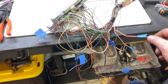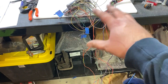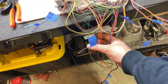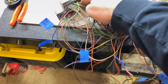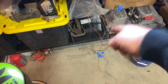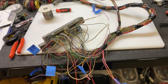I could do the two-relay style and add fans on later, which might happen — I don't know yet. I do like having an open wiring system because it's easier to maintain, but a sealed system looks tidier. I'm going to have to tidy these wires up because they look rough right now. Most of the wires coming out will be extended — like the ignition wire will get brought over and hooked to the MAF. I'll also cut the crank wire down since it doesn't need to be that long.